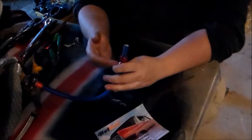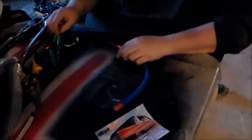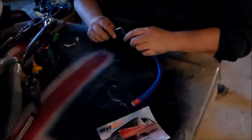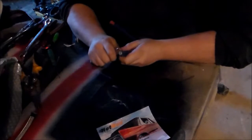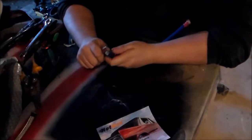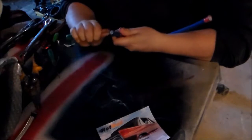What I'm going to do is push mine back, because you have to pull back the nylon about a quarter inch and the stainless about a quarter inch. I tend to use a pick when I do it because this stuff can be really sharp and can leave your fingers full of holes — that just does not feel good. So I'm just pulling back the nylon. You can use a pair of scissors and trim off the nylon if you can get it off.